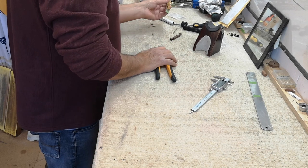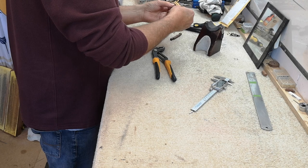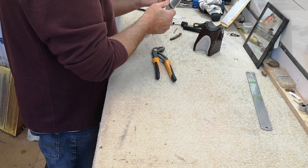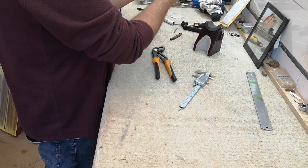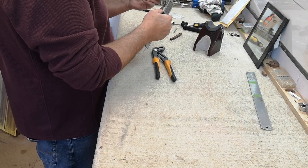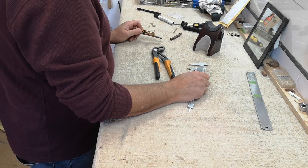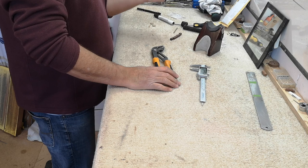Now obviously you can see that is much too tall on those spikes. We have no need for that. We do need a bit. Let's give ourselves a little bit of room, because Andy may want to raise it or something. We said that the height of 20.48 was a little bit too high, and he was looking to reduce that. So we're now saying we've got 19.82. So that could go down a millimeter from its original position, and I'm still up a bit. So we can go down from the 20.48 to 18.8. So that's 1.4. Is that right? 1.4, something like that. 1.6. Actually, about 1.5. So it's about 1.5 millimeters drop available now, thanks to doing this.